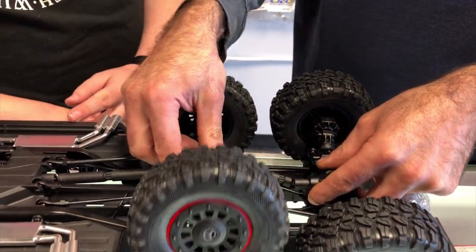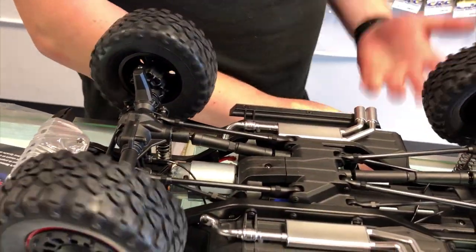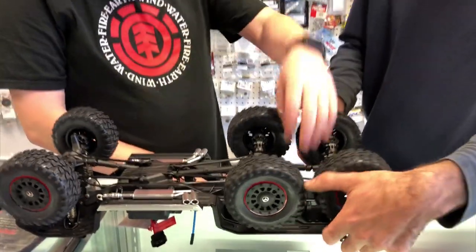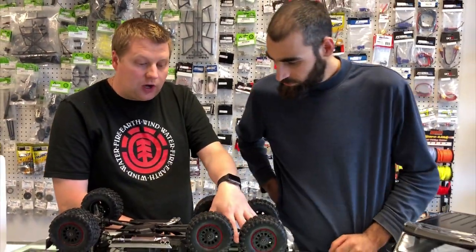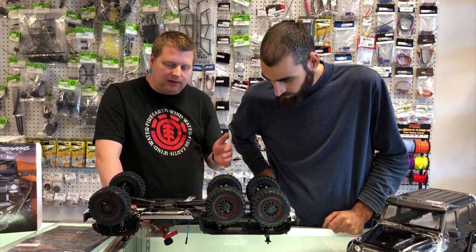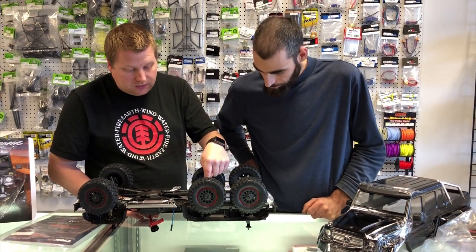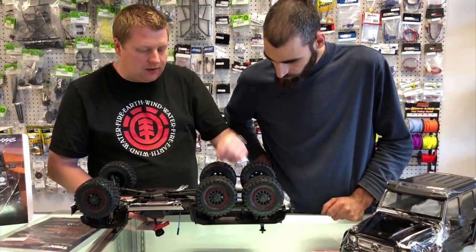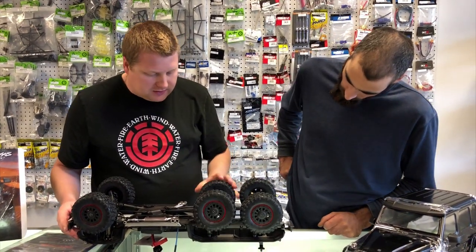They really made a point of making this a lot better than the SCX-10 6x6. So all four links front and back for the two axles. Like I said, the diffs will lock. Portals on all of the axles as well, so you don't lose any of the height between the mid axle or anything like that. Brand spanking new mid axle too. Before, you did not have the PTO diff cover output for it, so that's all brand spanking new for this as well.